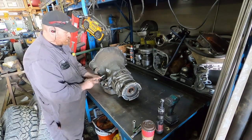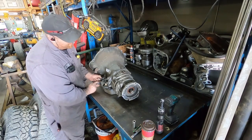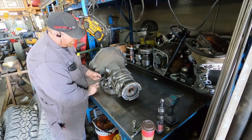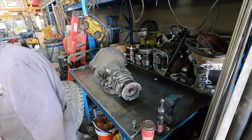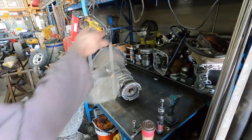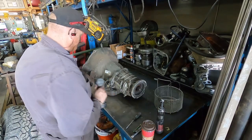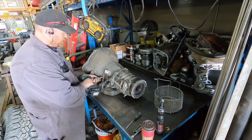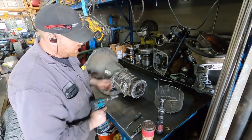But I have had a few of these things apart, so what you need to do is get your TV cable lever and your parks and your selector lever off. Not all of them are the same size. I don't smash myself in the face. I'm just gonna grab a basket, and I'm gonna loosen off the front band, which wasn't tight anyway. Like I said, none of this stuff's probably gonna be tight because I have had this thing apart before.